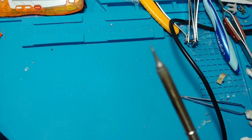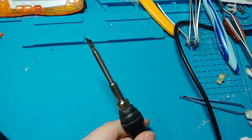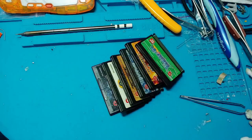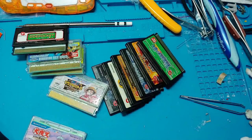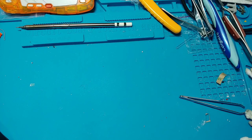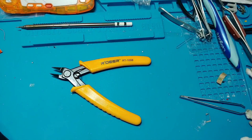You'll need a soldering iron — chisel tip works best on this one. The ideal temperature will be around 275 to 300 degrees Celsius. You'll need a hankering for games none of your friends will ever care about. You'll need some conductive pads. Optionally, you may want a screwdriver set and a spudger. And flush cutters — not to be confused with flesh cutters. That's from my other channel, Tanner Does Body Mods.